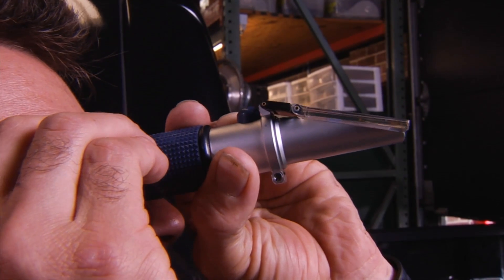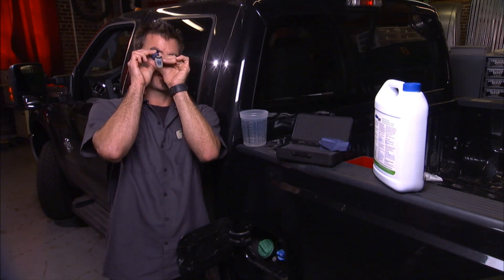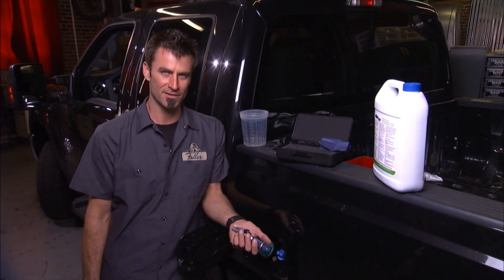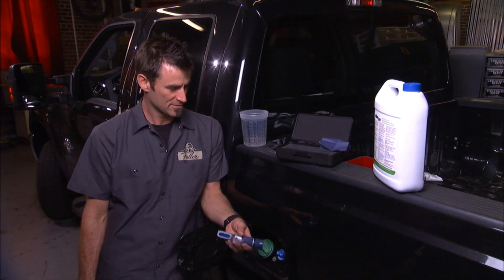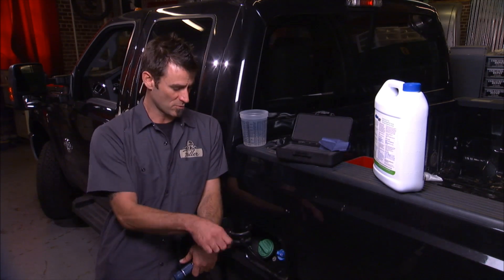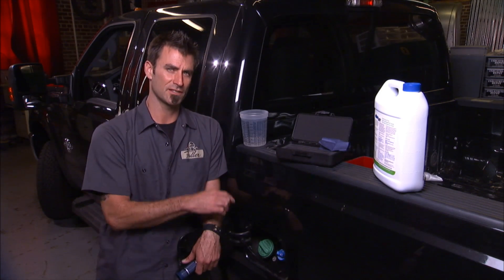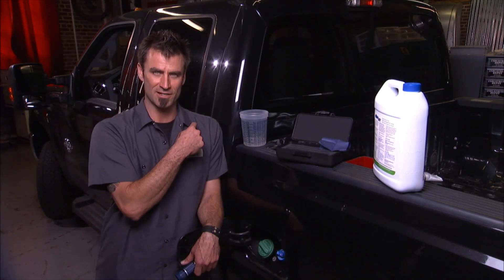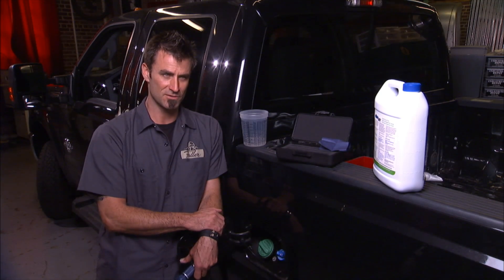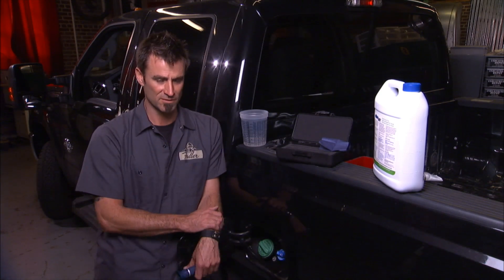What you're looking for is 32 and a half percent urea. If you've got that at 68 degrees Fahrenheit, then your mixture is proper and you have what you hope you bought. The other thing this could be good for is, let's say someone cheated — comes into your shop, pours water in here, doesn't work, it's throwing codes to the computer, puts it into limp mode — and before you go ahead and change out the computer, you can test your urea and make sure your DEF is the proper mixture. And for an inexpensive tool, that's a pretty powerful thing.